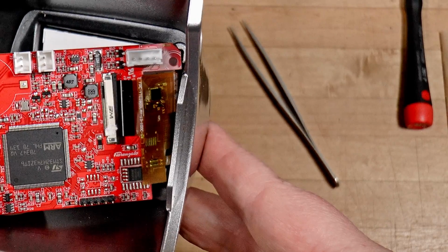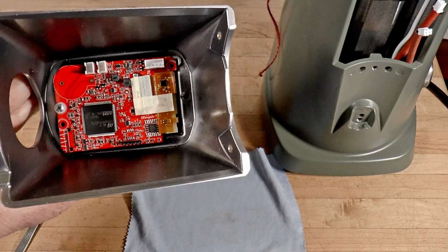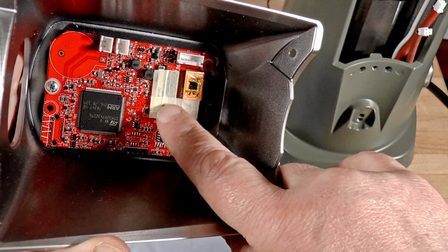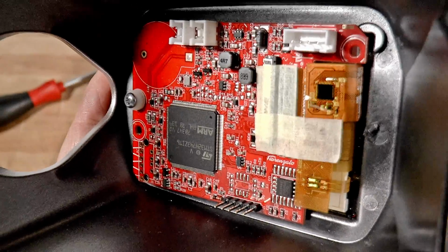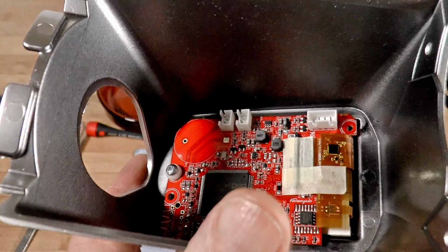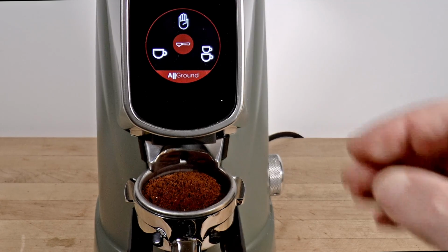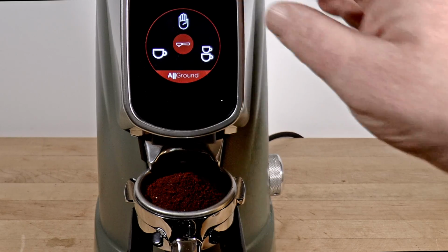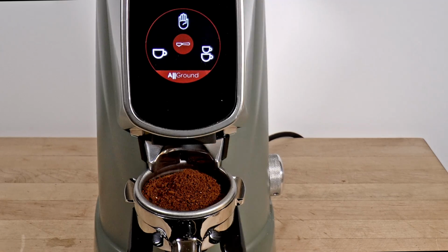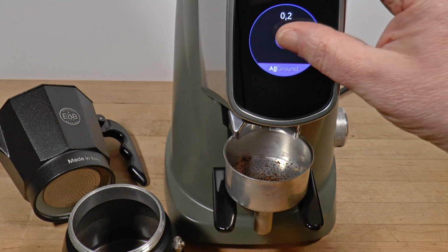I thought, surely this is causing the problem. The failure was intermittent, and this looked like a part that might jiggle loose occasionally from motor vibration. So I reseated the ribbon squarely and made certain the wedge clamp was all the way snug and taped it again. Okay, maybe I got a little carried away with the tape, but I wanted to be sure it wouldn't shift or creep over time. I was pretty confident that I'd found and fixed the issue. So imagine my disappointment when I tried it later, only to see the same behavior. The touchscreen worked a lot of the time, but the power would cut out prematurely at random intervals. I found it very frustrating because I like everything else about this grinder.